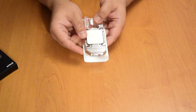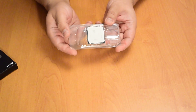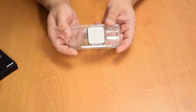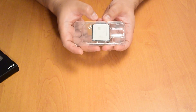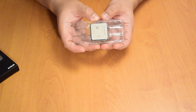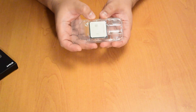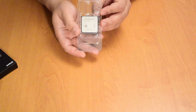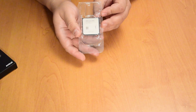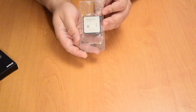The price is $49, so it's quite a bit cheaper than the Athlon 240GE and even cheaper than the 200GE. One big difference is that this CPU is now fully unlocked, so on a B350 or better motherboard you can overclock both the CPU cores and the integrated video. So let's start testing.